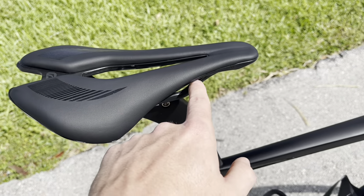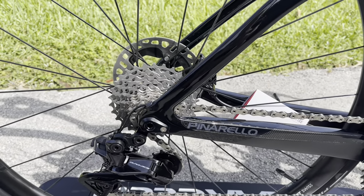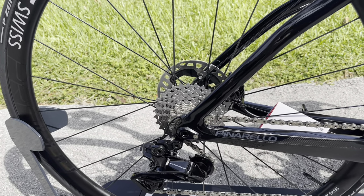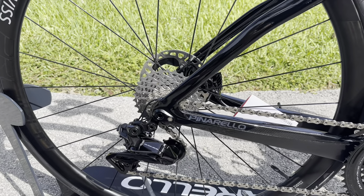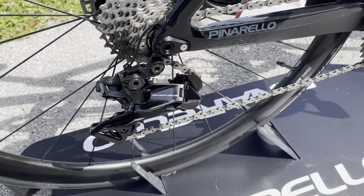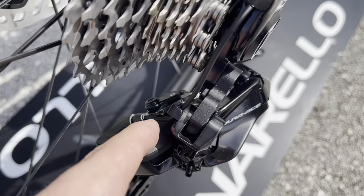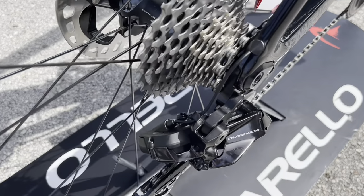We have a Most carbon fiber saddle with carbon fiber rails and carbon fiber body. Going to the back, we have the 12-speed Shimano Dura-Ace chain and the new 12-speed Dura-Ace cassette with an 11-30 range. This 12-speed cassette can still work with an 11-speed hub, though they did make a new 12-speed hub as well. With a 12-speed hub and cassette you get a little better engagement and quicker response, but the 12-speed hub is backwards compatible with 11-speed wheels — great news, as Shimano isn't rocking the boat. The rear derailleur has a slightly longer cage; looks really clean and sleek. They also have a cable guide clamp that looks great — small things that mechanics and bike shop enthusiasts really appreciate.